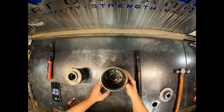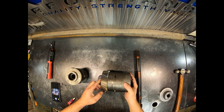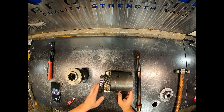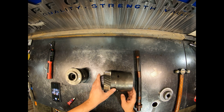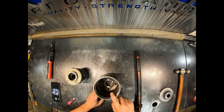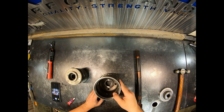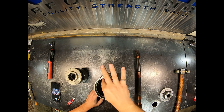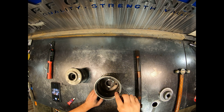The other major component is your center differential housing. This has a bearing on each end — normally we replace these because they tend to collect a lot of dirt and get scored and scratched up. These are also a very good trap for trash, so you need to be very careful cleaning them out — it's extremely difficult. If you have an ultrasonic cleaner that's a great way to go. Use a toothbrush to get inside each one of these splines and get all the material out, otherwise it could get into your new transmission fluid after a rebuild.